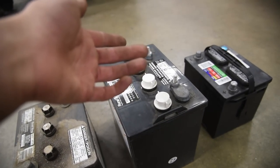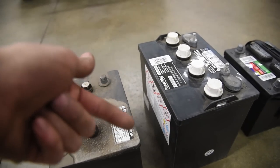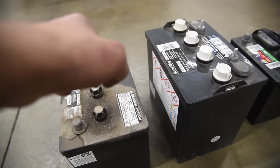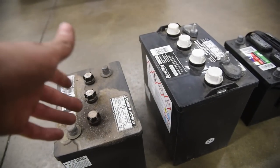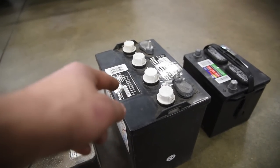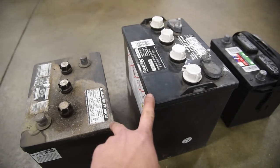If there's only a 6-volt and a 12-volt system, why would there be an 8-volt? The problem with 6-volt batteries is they just can't turn the engine over fast enough. If you listen to an old car cranking the starter motor, they sound really slow compared to a 12-volt starter. So what people would do to band-aid a bad electrical system is buy an 8-volt battery — these are totally safe to run in a 6-volt system, it just gives a little bit of extra juice to run that starter motor. So both of these batteries are commonly found on a 6-volt electrical system.